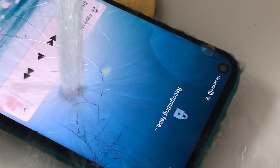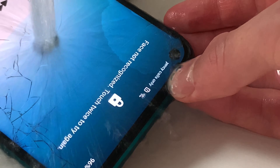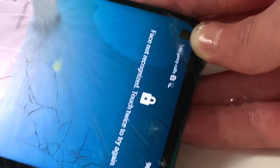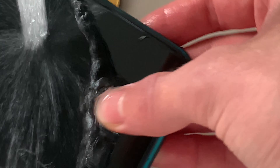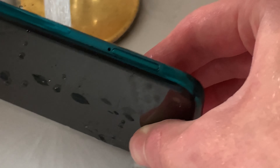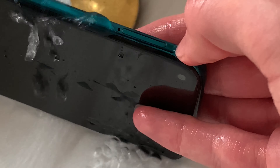Let's do it a bit more. It's from the SIM card part because the SIM card was stopped — the SIM card is not working anymore. We can see the weakness of this phone is the SIM card slot, right here. That's where all the water is coming in.